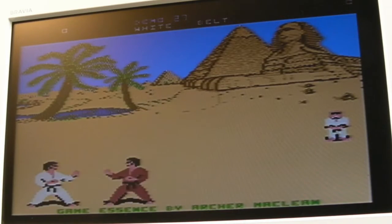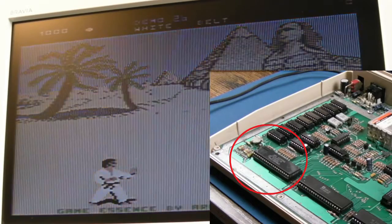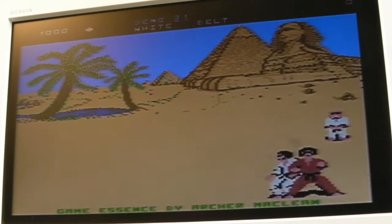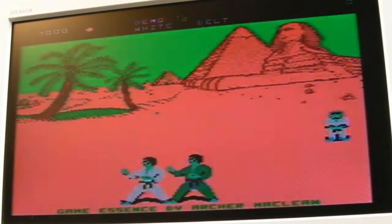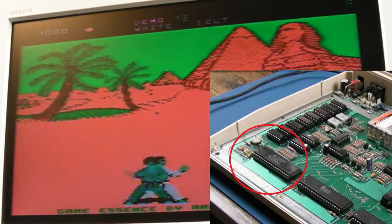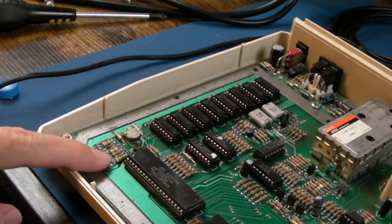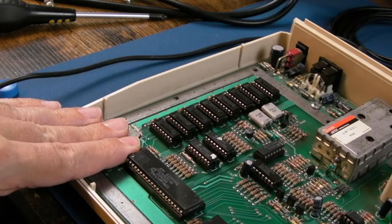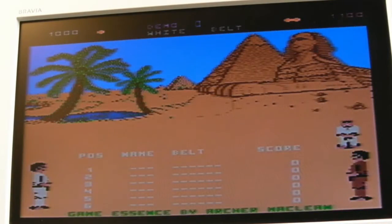There they go. Colour started going again. Let's just heat the colour transistor. No. Oh, hang on. Yeah, heating that transistor. There are some components nearby, let's heat those. Yeah, look, I'll show you where I'm heating. Yeah, well, I think we've got a temperature sensitive cap there. It's a capacitor thing, I think. So it's here somewhere. It's not the transistor, it's not that. Let's just try and cool this area down. Let me blow it. So you can see we've lost colour totally now. See that?